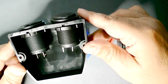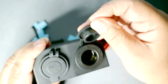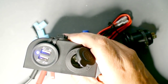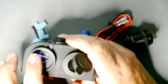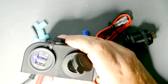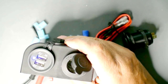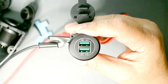I got a generic holder that holds these 2-inch devices — this one has both an accessory outlet and a USB output. When I turn it on and look at my power supply, it's drawing about 10 milliamps, mostly for the light. So even when on standby, this light draws some current. In a boondocking or storage situation, we want to eliminate that residual current — 10 milliamps doesn't seem like much, but with 3 or 4 of these devices plus other gadgets, it adds up. I'm going to replace that with a Quick Charge 3 outlet.